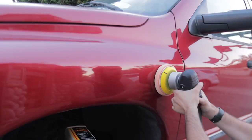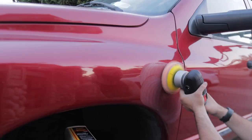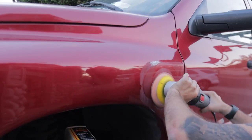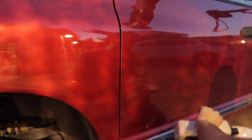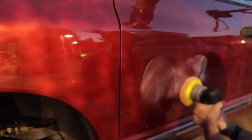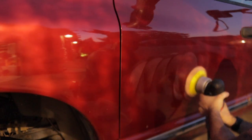For those with a slightly older vehicle, these are the extra steps you'll need to take to get rid of those worn-in, faded oxidation marks that were around the emblems. I'm using a Porter Cable dual-action polisher and some Meguiar's heavy-duty cutting compound, and it made really quick work of it. Between the fender and the panel, I had maybe 15 to 20 minutes of polishing total between the two — if you've done polishing, you'll know that's really not all that much.